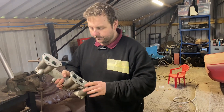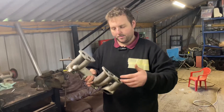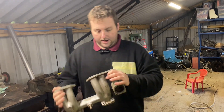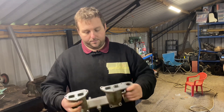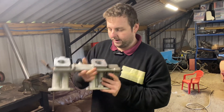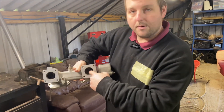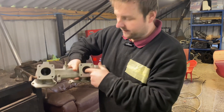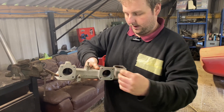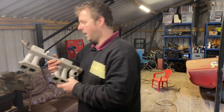What you want is a slightly rough finish so the air is a tiny bit turbulent and mixes the fuel properly. That's too rough for now — it needs to be finished off with some finer tools yet — but a slightly rough finish is the goal. That's the start of the manifold, just three more to go. On the other side, inside where it splits, I'm going to carefully get in there and knife-edge it so it flows better each way and you haven't got such a big obstruction in the way.